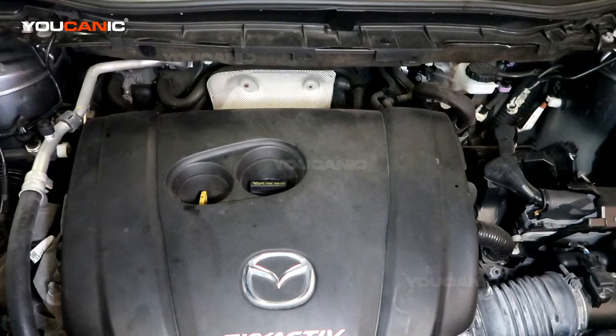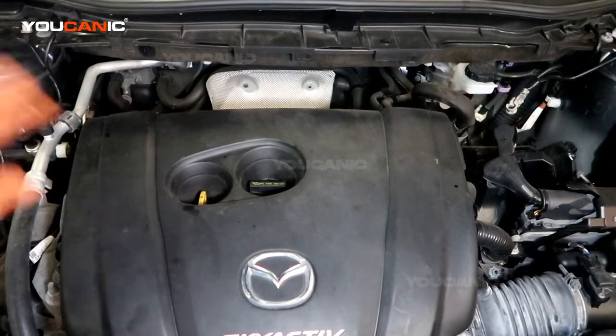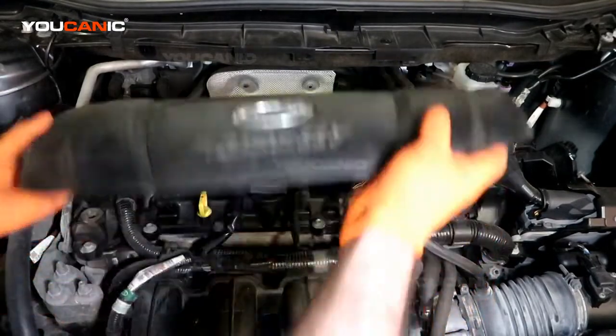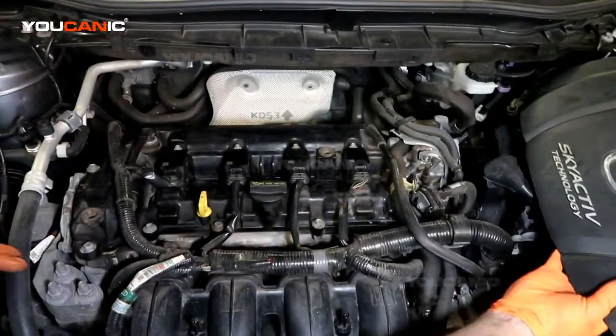To start with you'll pop the hood and be able to support the hood up, disconnect the negative battery cable because we are dealing with the spark plugs and it's just a good practice. And now with that all done we can go ahead and just pop this cover off. This is just held on with some rubber grommets and we can pop and put that to the side.